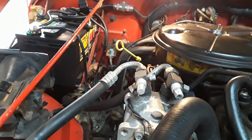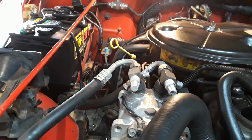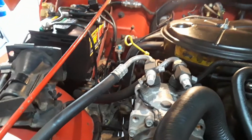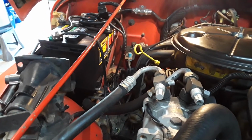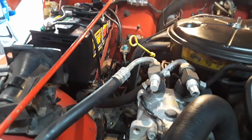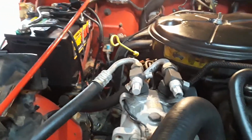But the rear defroster, I turned the rear defroster on, that gauge would drop down. The heater, I turned the fan up to the number two position, that gauge would drop down. And not only would the voltage gauge drop down, but my oil pressure, my gas gauge, my temperature gauge, they would all go down a little bit. And that tells me they weren't getting the voltage or the amperage, the current, whatever you want to call it, that they needed. By doing that, it fixed it.